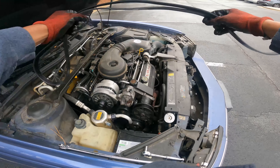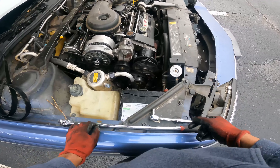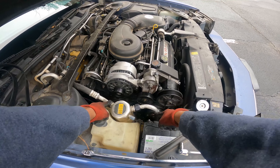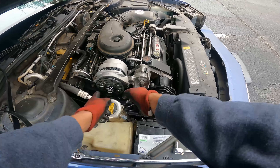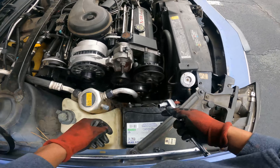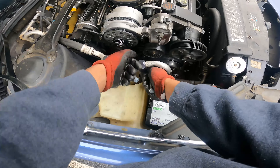Just like that the belt is off. I don't know if y'all can really see but there's a lot of buildup around it too, so I got some brake cleaner where I'm gonna spray all that off. In order to access this you have to move this AC canister out of the way.